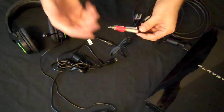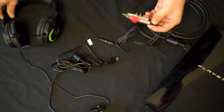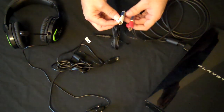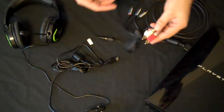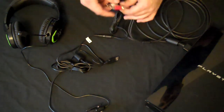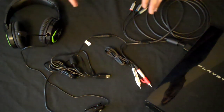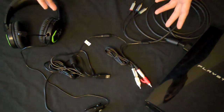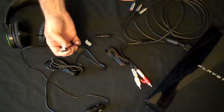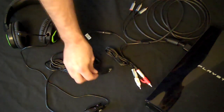Your HDMI cable can be plugged in for video, and then your audio gets set up through the RCA cable. Instead of having digital audio, you want to have it through RCA audio, and then you get your audio coming through your headset. It's pass-through so you can plug this into your stereo system or directly into your TV, allowing you to play audio through your stereo as well as have audio in your headset. It's a much easier configuration than the Xbox, but both are straightforward once you understand the reason for each — the USB cable is the microphone for PlayStation but just powers the headset for Xbox.